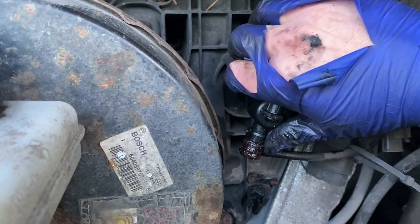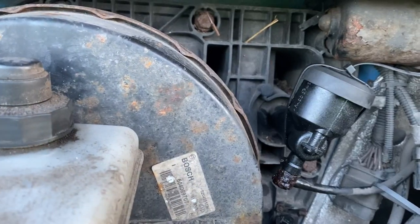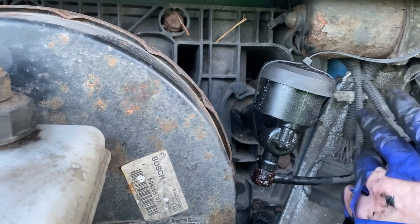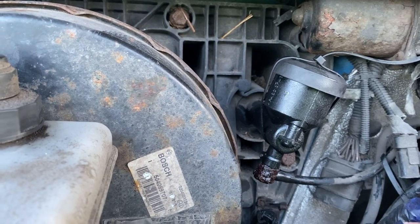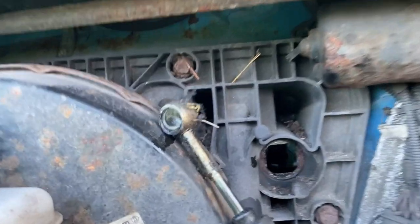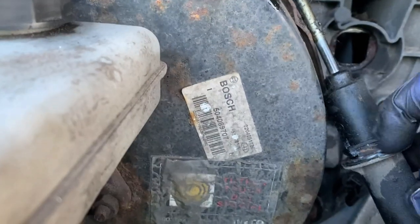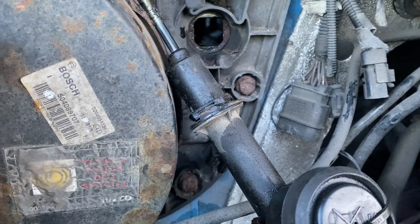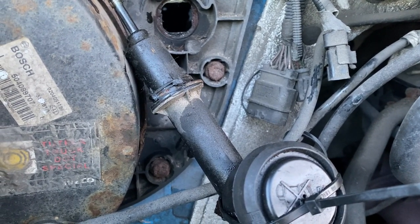Right, so I loosened it there with both hands. As you can see, it's turning. You can feel the resistance from the back. As I say, I think I'll need both hands to get it out. But it's half a turn clockwise. So let's get this removed. So there we have the master out of the bulkhead. As you can see, obviously the little lugs there locking to the back. So now it's just a case of withdrawing the old unit out, getting the new unit fitted in reverse.